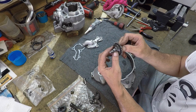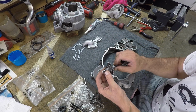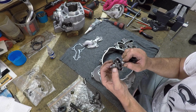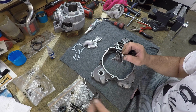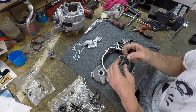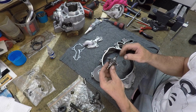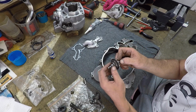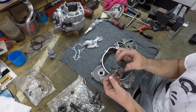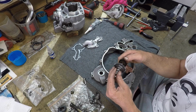This is that centrifugal wheel that I was talking about on strip down. So this is running off of the main crank, so the more that spins, the more this spins, and the more it spins, the centrifugal nature of it pulls that out, which actuates the arm, which then actuates the exhaust ports. But motorcycle engineering being beautiful and succinct, this is the power valve actuator, but on the other side of it is the water pump for the coolant throughout the entire engine. Just salvaging little bits off other things to make do, just so smart.